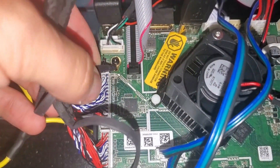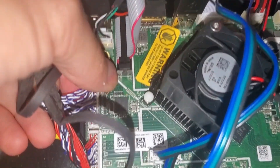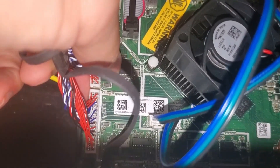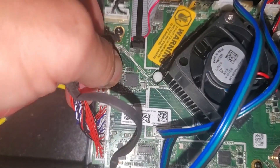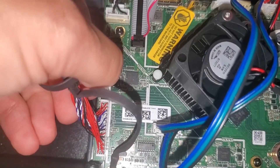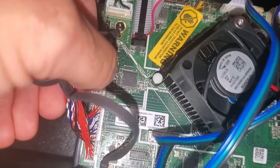This cable goes all the way down to the bottom. Check the ground cable connection and make sure it's solid — it should be tightened down. When removing connectors, squeeze the connector itself; don't pull on the wires because they can rip out. To reseat it, grab the connector, wiggle it out, then line it up with the edge of the connector to reseat it.